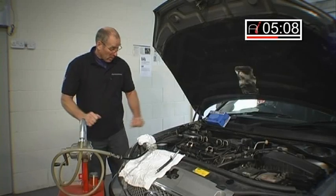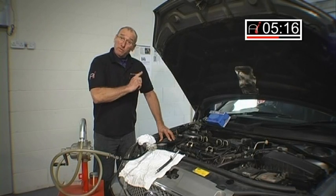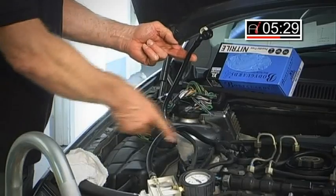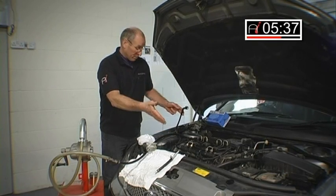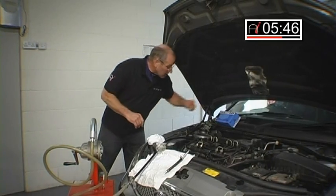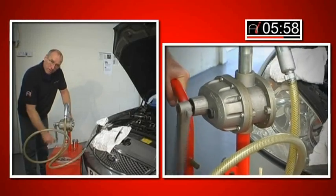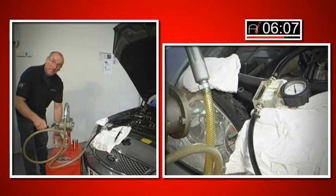This now is our fuel supply. I can now draw fuel from the tank, which will fill the filter until I'm satisfied enough fuel has passed through the sight block to enable that filter to be full. I then intend to reverse that connection and prime up the high-pressure pump by pumping in the opposite direction into the high-pressure stage — priming not just the filter, but the high-pressure pump. The first stage is, in effect, technically emptying the vehicle — removing fuel from the tank. By turning this anti-clockwise, we're pulling fuel from the vehicle fuel tank into the filter housing, filling it, and pulling the fuel into the tank on this pump.